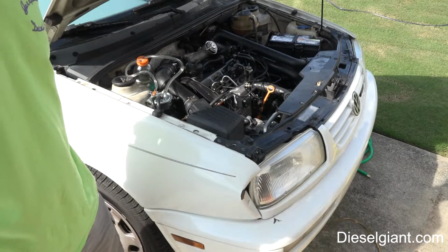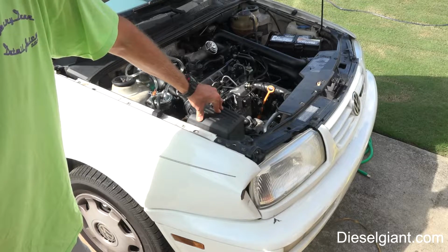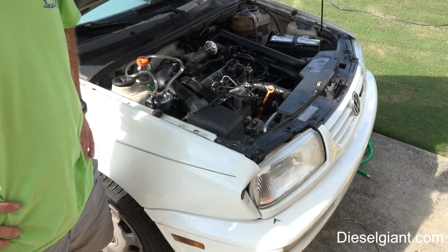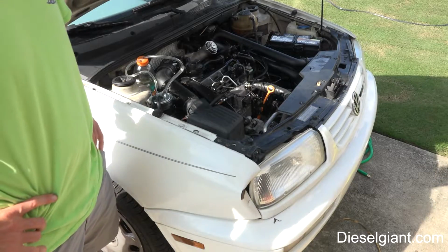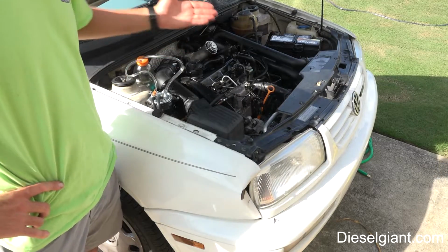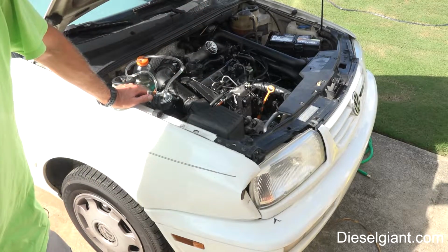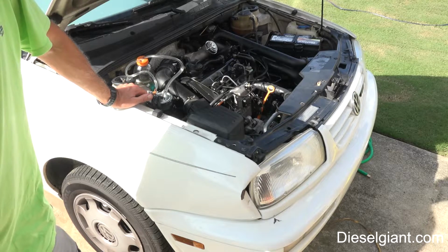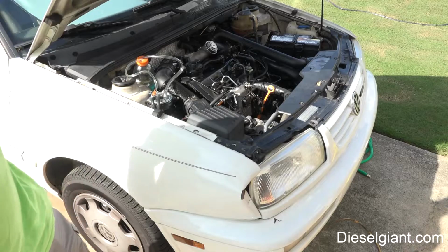The bottom line is this pump, the car has 378,000 miles. The pump itself has, I believe, about 320,000 miles or so. And I've talked to several pump rebuilders, and they said that that is absolutely phenomenal to get that amount of mileage out of a pump. I've used the AMSOIL fuel additive in here pretty much its whole life to lubricate the pump, and it's obviously done a phenomenal job. But pumps don't last forever, and this one has not.